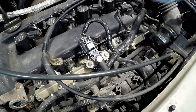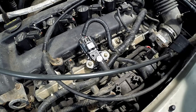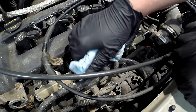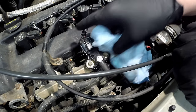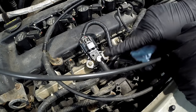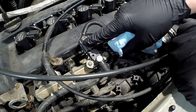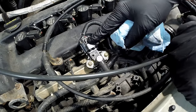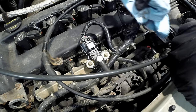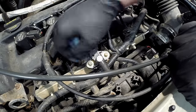Get your rags out of there, and make sure any fuel spilled anywhere is cleaned up. Then turn the key on to pressurize the fuel system a couple of times and make sure there are no leaks before starting the engine. You don't want heat involved where it could be potentially dangerous. Turn the key a couple times, pressurize it, let it sit, come back and inspect, and then you'll be safe to start the engine.